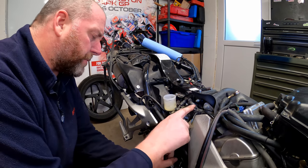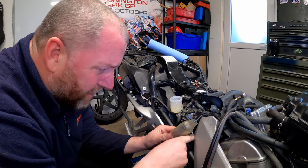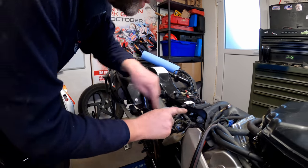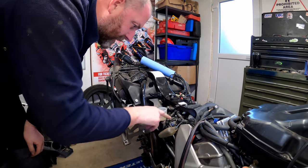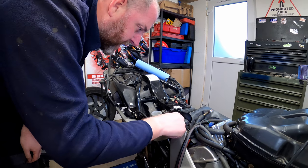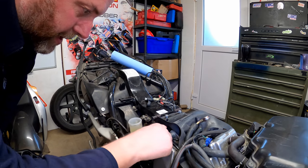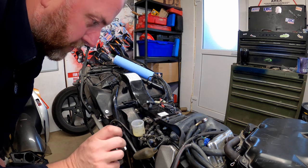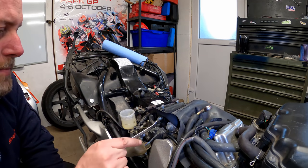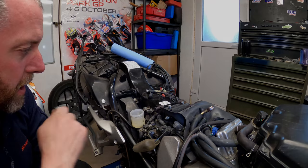Okay, we've got another block up here with a hard line on it, which comes down from here. And we're going to next, I think, do this line here. And I think in order to get that one off, I'll loosen the banjo up here, loosen this, because in order to get this end out, we're going to need to move this block out of the way. So we'll crack all these bolts and all the banjos so that we can move it all out of the way, and then we can swap the line over.